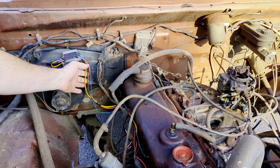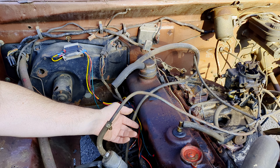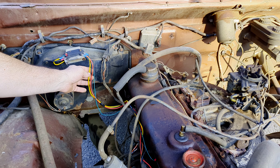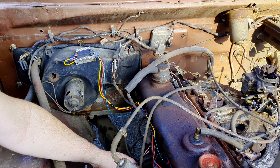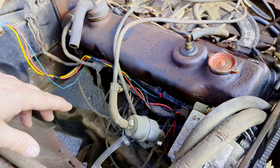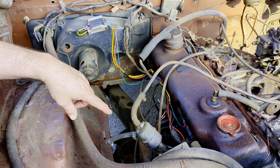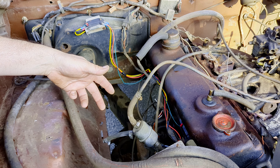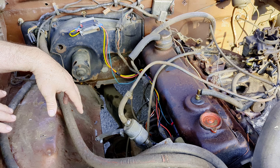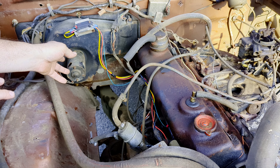This HEI mod has worked out really well. There's only just a few wires that you have to do. There's a ground right here on the green one right there — we just did that simple. You've got your power, then you've got your VR sensor going basically into the distributor. This allowed us to use a vacuum distributor to give us a different kind of advance. Because with the lean burn, there was not as much control at all with the ignition. So this helped out quite a bit and really it's a simple mod.